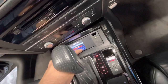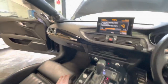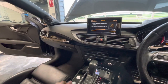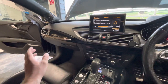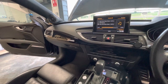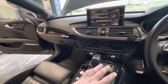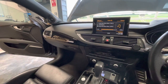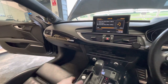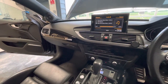We had two presets on the director. There's an SQ preset, and then number 3 is the bass preset where there are different settings for the mid bass and the sub — the sub can come alive and go mental, crazy. These two subs can move the car and move a decent amount of air, yet stay very musical. On the SQ preset, subs are EQ'd and tuned so differently that it blends into the front beautifully. The mid bass also plays low on the SQ preset, but on the bass preset they are crossed higher so you can really feel the music.